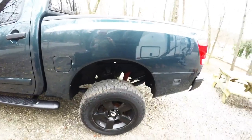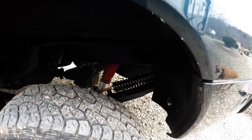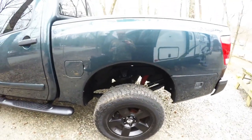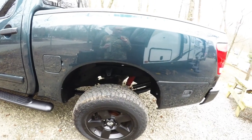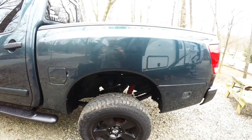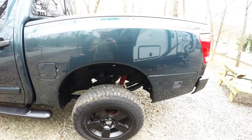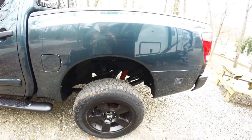We also added a Roadmaster Active Suspension system to the rear leaf springs — basically like an overload spring. The truck has Deaver leaf springs with a lift kit and Rancho RS9000 shocks all around. The truck felt pretty stiff going down the road with very little squat. The Roadmaster pretty much eliminated any axle wrap I used to have even before being hitched up, so I definitely recommend that system.